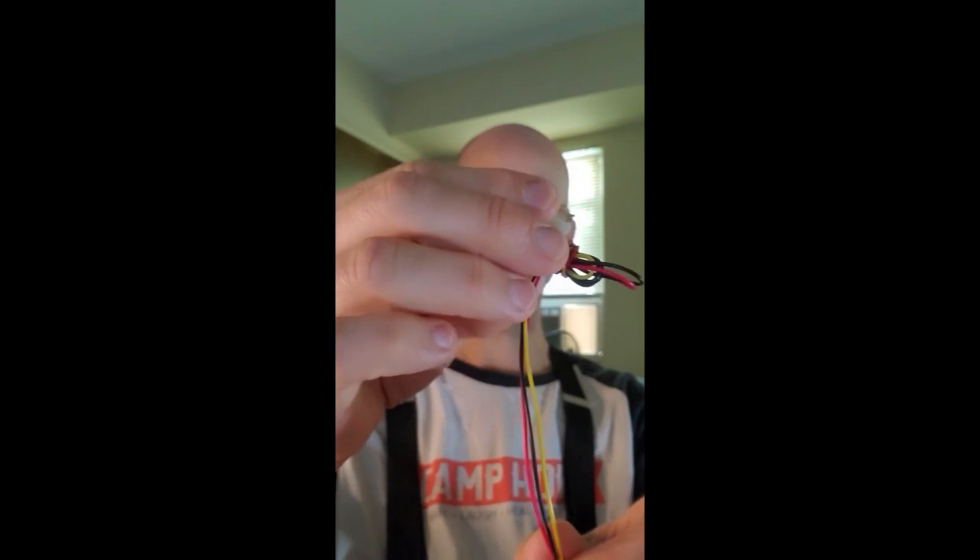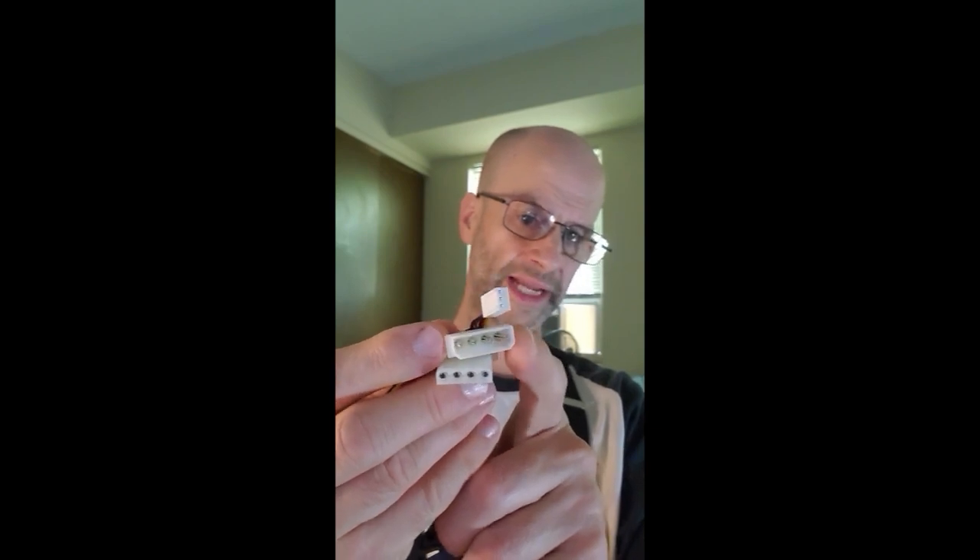There's also a configuration where a fan has male and female Molex and a three-pin, and you might find a PWM as well — but if you use the Molex, it's not going to behave like a PWM unless it's properly wired. As you can see here, this one has only three wires: four tubes and four pins in the Molex connectors, but only three wires, so this will not behave like a PWM fan even with the Molex. You will see some where there's a PWM and a Molex connector together.